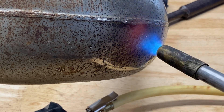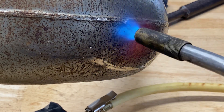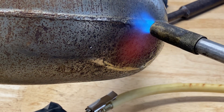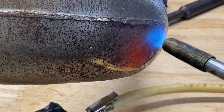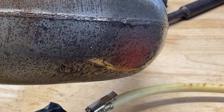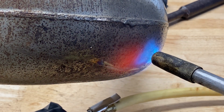I wanted to mention that if your exhaust has a lot of dents, they can rob your horsepower by up to six percent and your torque by around four percent. So you definitely don't want too many dents in your two-stroke exhaust pipe because you're just robbing yourself of performance.